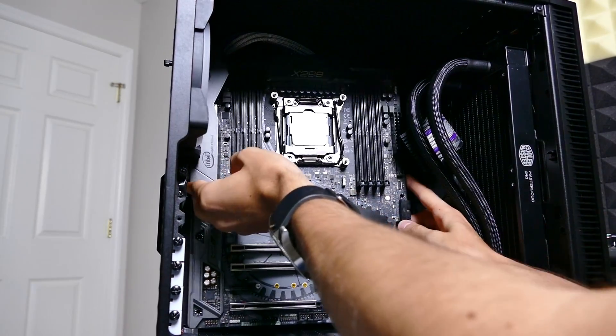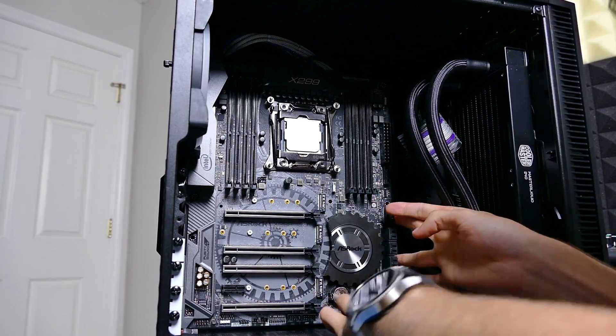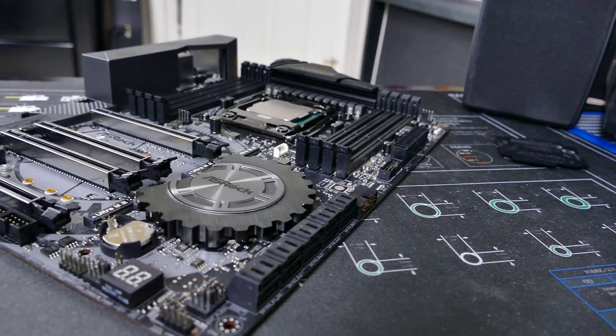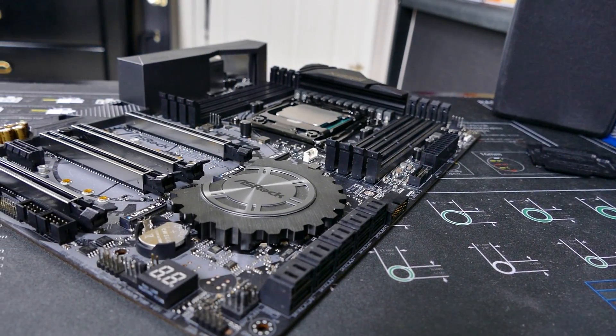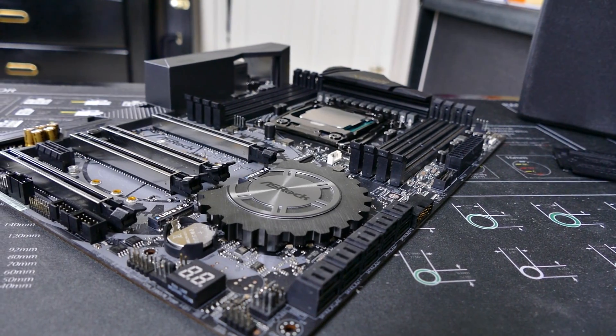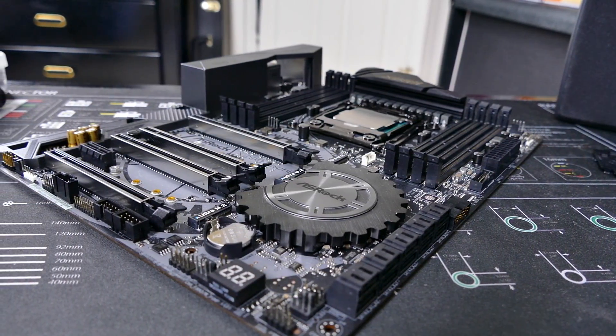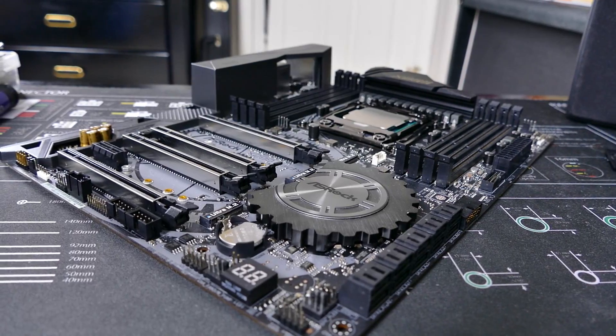This was achieved with a 240mm AIO, which is severe underkill for a CPU of this caliber, and a single 8-pin EPS power delivery format. A few in the tech community have pointed out temperature issues along the 8-pin cable when a supplementary 4 or 8-pin connector is missing. This board only has a single 8-pin.